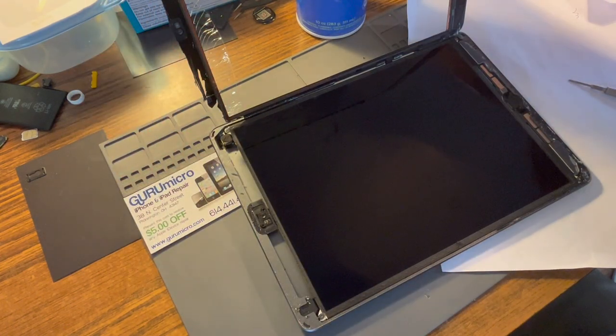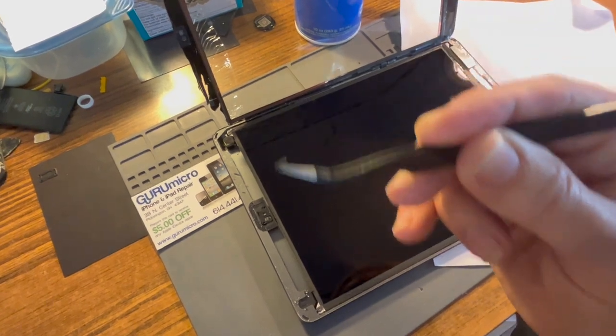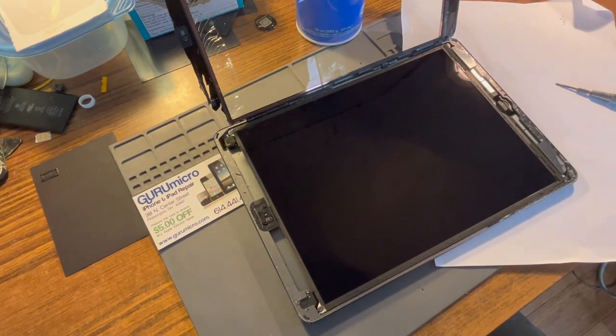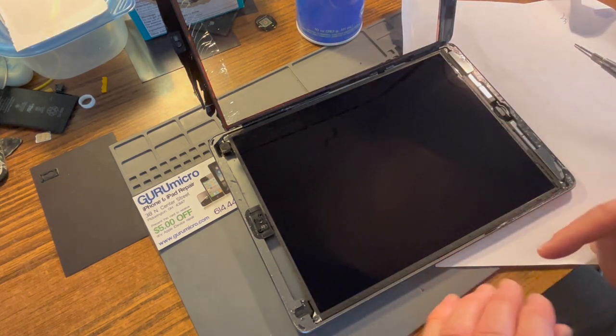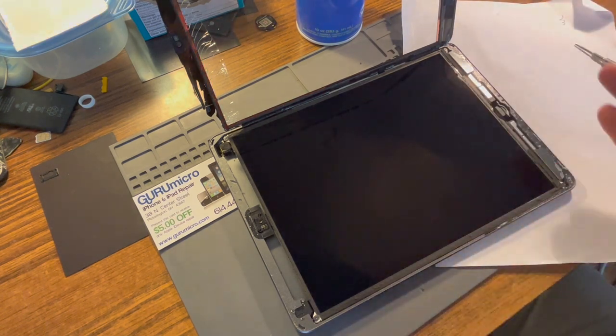Sometimes you'll see where the foam seal tears and you'll get little pieces. I do like to pick those up when I see a big hunk sticking up because they can be sticky, and if those do get on the LCD it can be hard to clean. Not touching the LCD is very important at this stage. Any pieces of adhesive around the edges that look like they're touching on the LCD — I always pick those off and then hit it with compressed air. There are four Phillips screws that hold this LCD in, right here in the corners. Just remove all four of these.